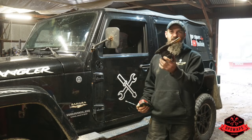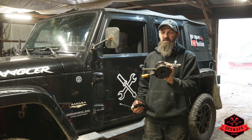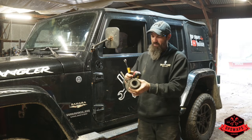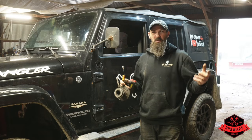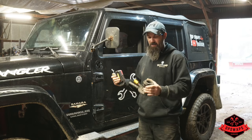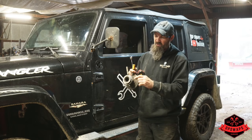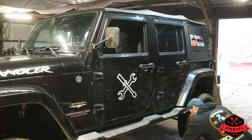We modified the clutch slave cylinder, or hydraulic throwout bearing, sometimes it's called, to get some more space, because that Duramax clutch is so thick. We drove it yesterday and we blew it out about halfway through our trip. So we're gonna rip the transmission back out. We're gonna see how much we really shortened and if this one will work better, and put this one in and see if we can drive it. Oh, we gotta put a U-joint in it too.